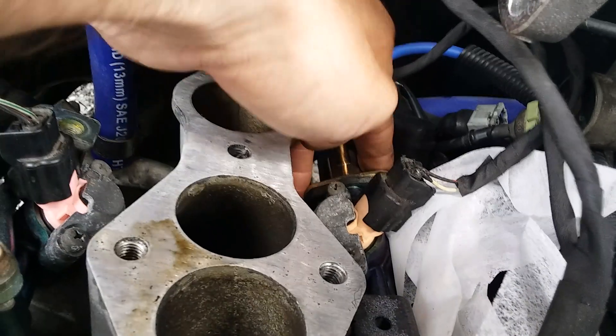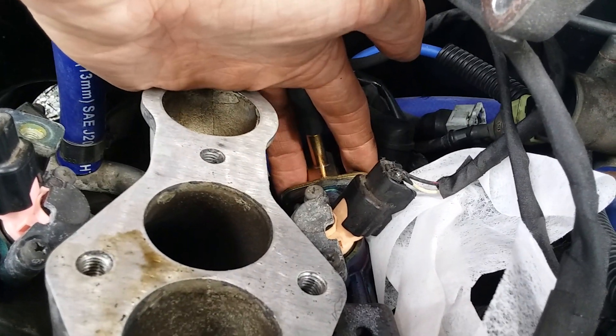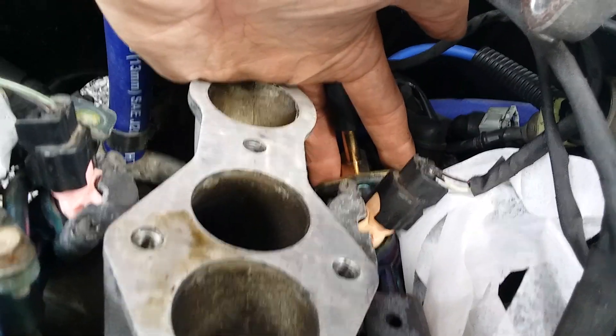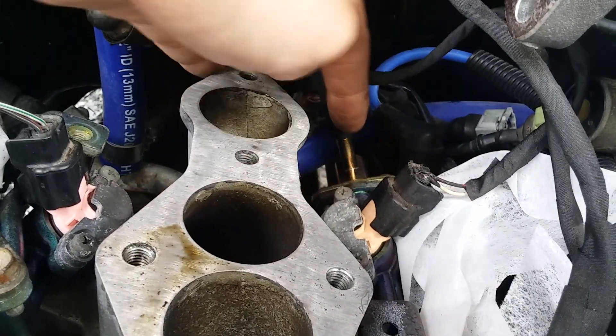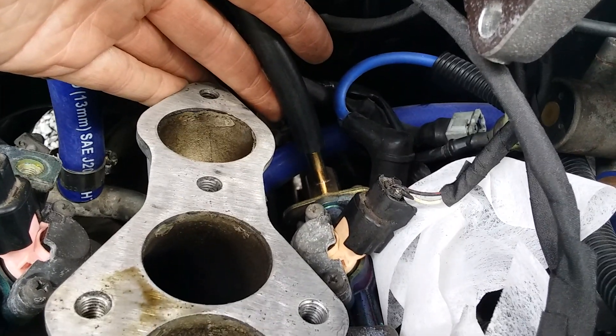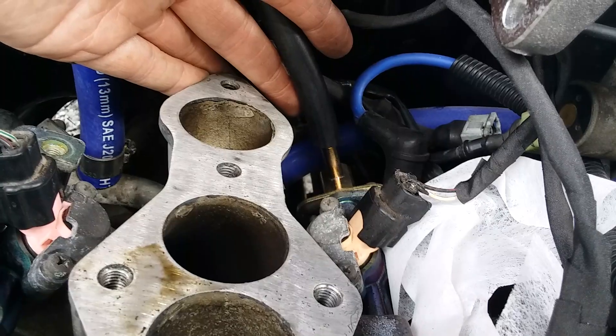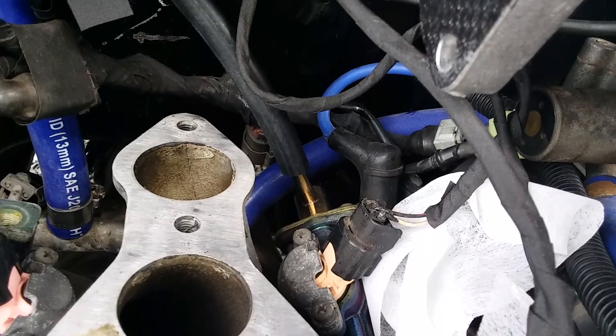What you do is pull off the two screws that hold the regulator on. You have to pull the blower off to get access to this, but once you get the lower pan off it's pretty easy. We got these two screws — this is a 90-degree elbow for an SR20DET, but it seems that Nissan pretty much used the same regulators all the way across the board, so that works out pretty good.